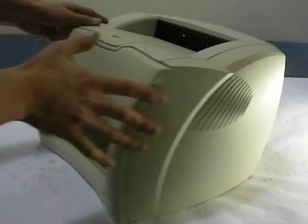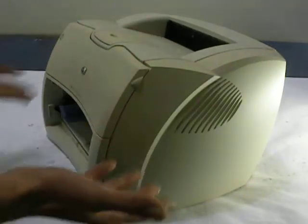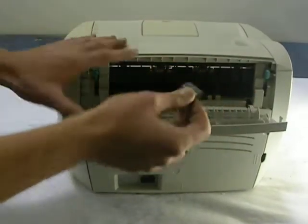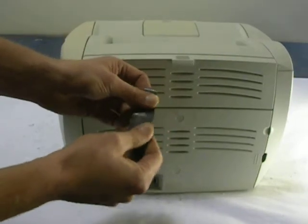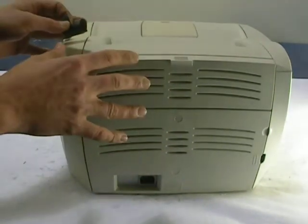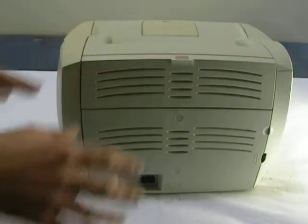But let's say you had some print quality issues that you replaced the toner cartridge and it didn't resolve it. And then maybe even in the worst case scenario, somebody had found some of this sleeve or the stuff that feels like camera film. That's actually part of the fuser sleeve, and you have no choice right now but to replace this fuser, or you could even, of course, re-sleeve the fusing assembly. And it definitely requires the fuser to be removed.